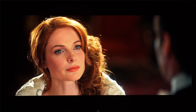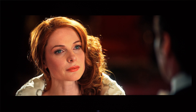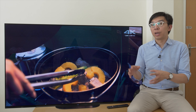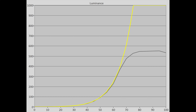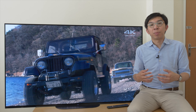During playback of real-world HDR10 content, the Sony AG9 equipped with dynamic tone mapping doesn't look dim at all in a side-by-side comparison with an OLED with a measured peak brightness of 700 nits. I despair when non-technical reviews claim that the Bravia AG9 looked duller than LG OLEDs or Samsung QLEDs. As you can see from this EOTF tracking chart, Sony is merely adhering to the ST2084 perceptual quantisation standard in an accurate manner, similar to a mastering monitor, before rolling off at the top end to preserve some specular highlight detail — unlike some other TV brands which are over-brightening their PQ EOTF tracking to achieve more HDR pop at the expense of image depth and accuracy.